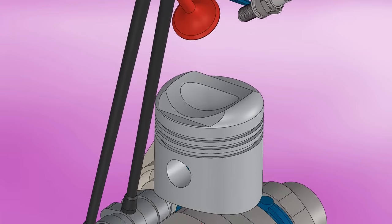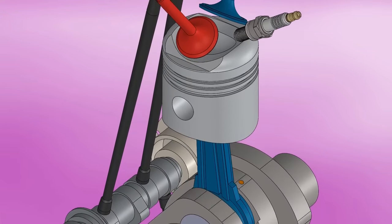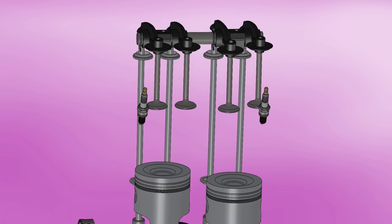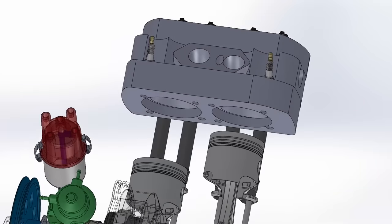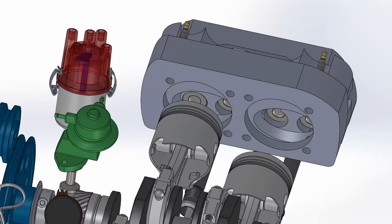The hemispherical combustion chamber is complemented by a very interesting piston. It has a cut for maximum valve opening and lateral shoulders to avoid losing compression caused by the well in the center. On the Beetle, the cylinder head has straight valves, which make it cheaper and easier to build, although it does slightly reduce airflow. The combustion chamber is of the inverted bathtub type, which reduces knocking and is cheaper to build than the 2CV's design.